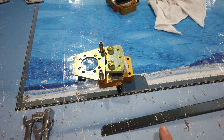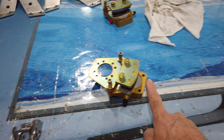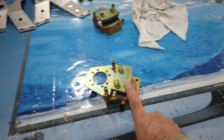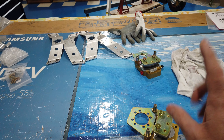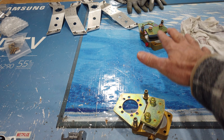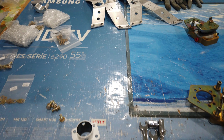I did incorporate the service bulletin that Van's had put out about upgrading to higher-temperature o-rings. I had bought the o-rings and had planned on taking the wheels apart to swap them out. When I found out about this new aftermarket wheel fairing setup, luckily the piston and o-rings are identical between the two calipers. So both calipers have now been fitted with the new high-temp Viton o-rings — that's been accomplished.